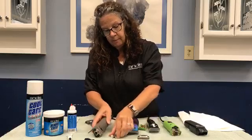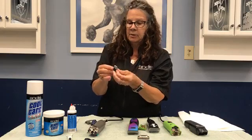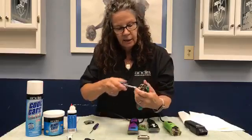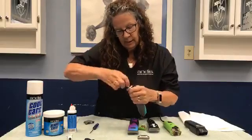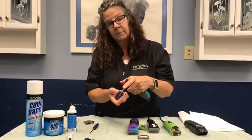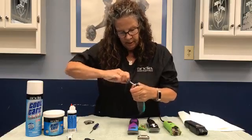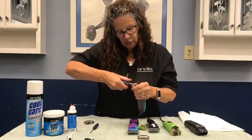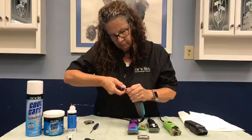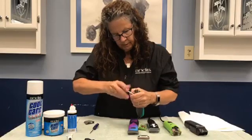It pushes the hinge up, and that releases your blade. I just pulled it apart. But it's very easy to fix, or very easy to change, I should say. You just unscrew these two, and I'll tell you, a larger flathead Phillips screwdriver is the easiest way to do this, because the non-flatheads tend to strip the screws, and then they're harder to get out. Just gonna unscrew them.